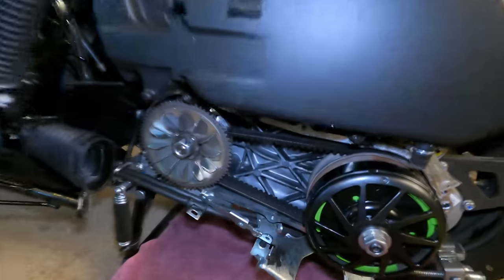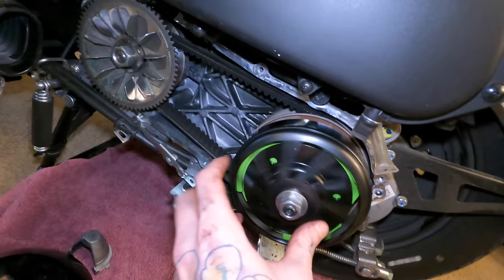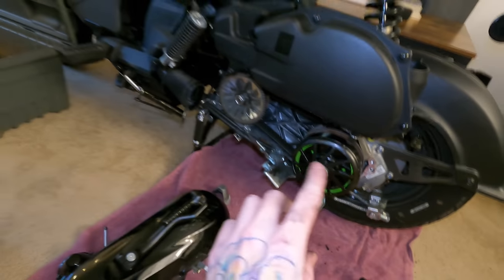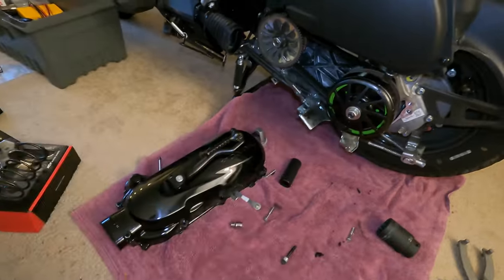Then you take the clutch and put the bell housing over that. Put the belt through that little groove right there and slide that back over the spindle, making sure to keep that in the groove. Take that washer, put it on, and thread that on to hold the clutch in place. Then we got those two pieces from the front that go right back on, followed by the washer and the nut. Then we just buzz these back down. Everything should be good — all nice and tightened down. Before I put all this back together, I'm going to pull the Navi outside and run it without the cover on to make sure everything seems like it's working.